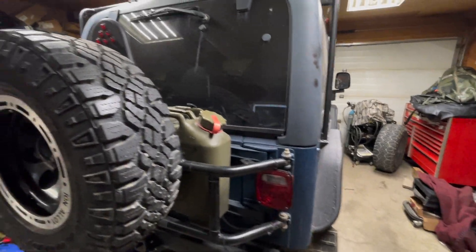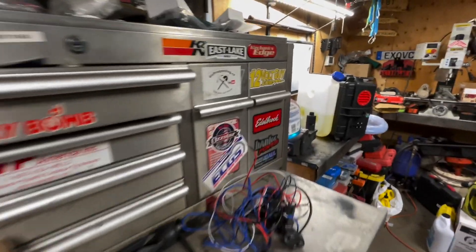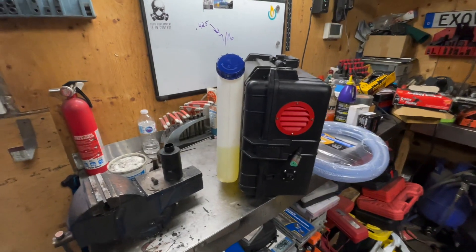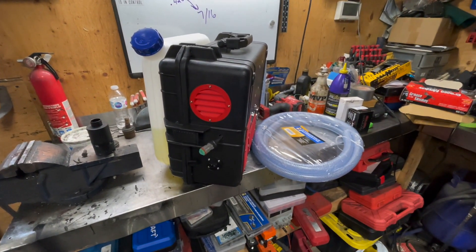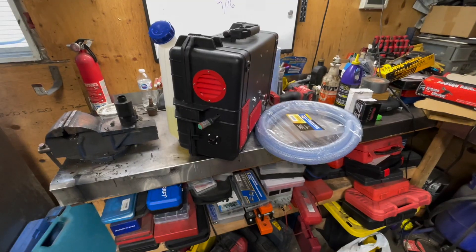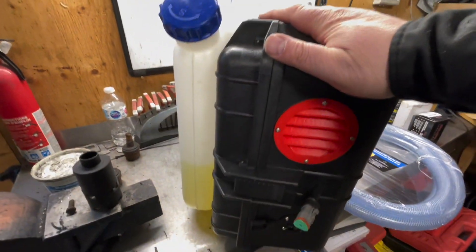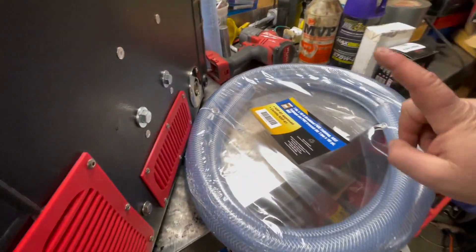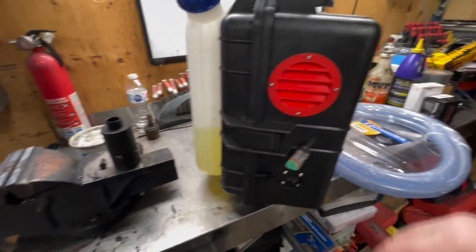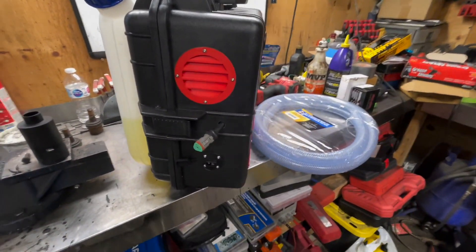Welcome to today's video, this is Jerry from Bullshit Corner. We're going to revisit the diesel heater before we get back to work on the Jeep. We're going to finish the deficiencies from our trip. That overheat code is probably from the air intake being inside the case, so I bought this one-inch tube, and I did keep the little breather which we're going to have to come through the case and up the top.